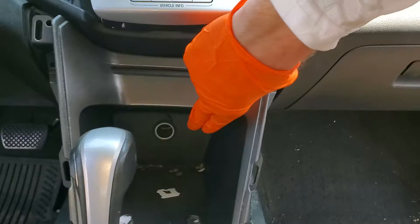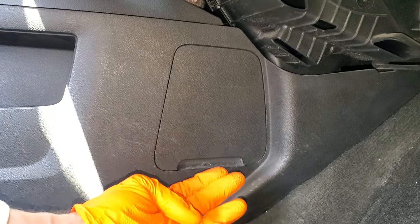What's going on fellas? I'm back at it with this 2012 Chevy Equinox. I'm showing you the fuses for the power outlet there, and there's another one in the back here right there. So I'm showing you both fuses for that and some other troubleshooting steps. We can get to the fuses by hooking in under here and pulling out.